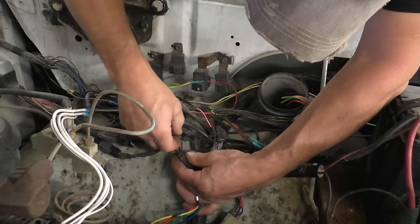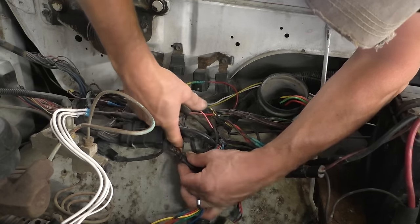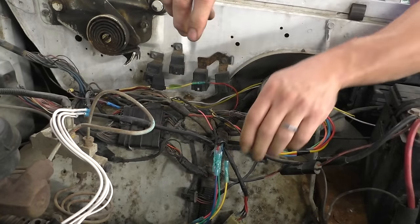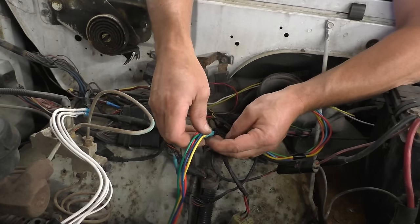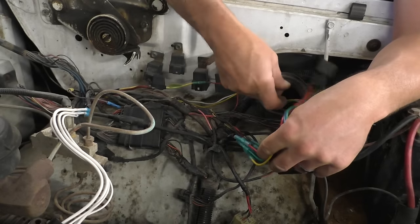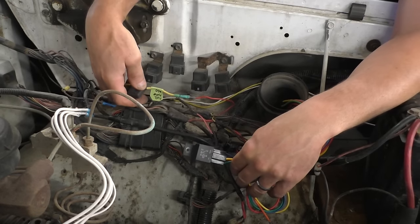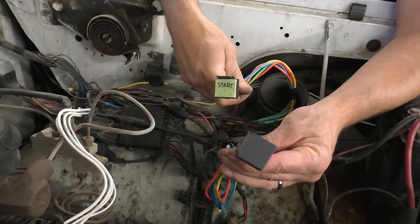Oh man, I thought I had some green crusties. I was like, oh, hallelujah. But to see if that's the fuel pump, we'll throw an amp clamp around it. In the meantime, you can come out, Vanessa. In the meantime, I'm going to heat shrink these down to finish this termination here. We'll get this set to the side. I'll put my new label on. I just labeled this fuel pump ASD, so somebody can see that. I labeled this one start. I'll label this one fuel pump.